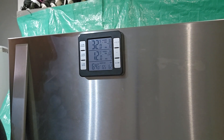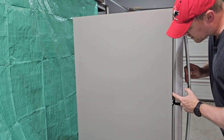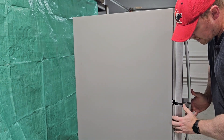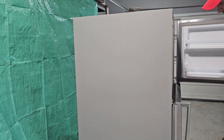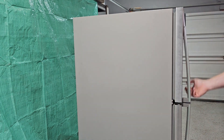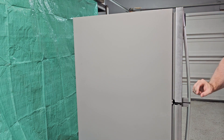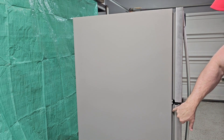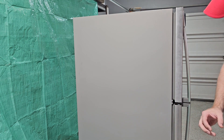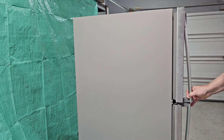We'll start out with the gaskets. Check them all the way around to make sure they're actually sealing against the fridge. As you can see here it's sealing quite well. Check the top of the gaskets to make sure they're not ripped. Check the bottom and top of the freezer and all the sides. If there is a big gap, the gasket may need to be replaced, or sometimes they can be stretched using a hair dryer — put a little heat to them and pull so it stretches, but don't pull enough to rip it.